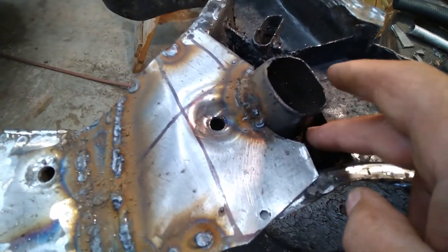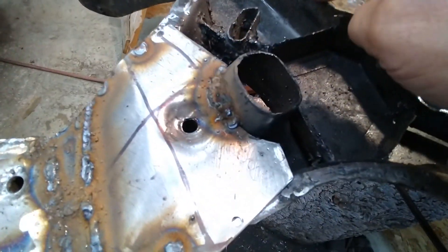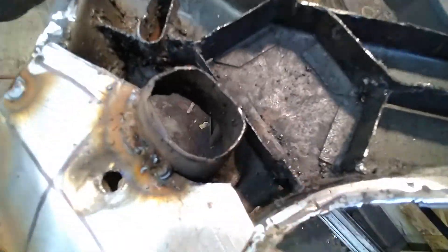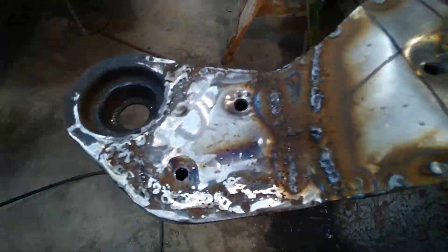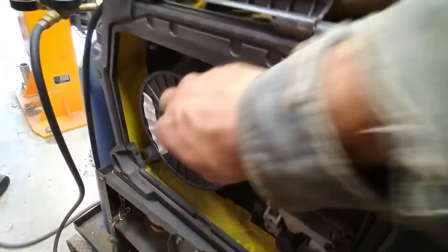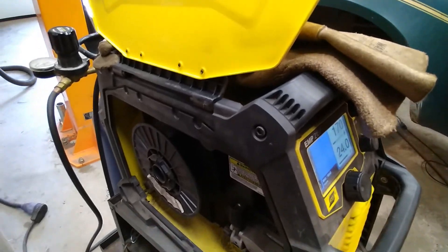It's coming along. I've decided to go halfway around this thing here, and then the next piece I'll put in will be this chunk here and join them together — it makes it easier to cut the hole for this piece out. That being said, I've just run out of wire on this welder. So this spool comes off and I'll put a new roll of wire on and load it into the gun and away I go again.